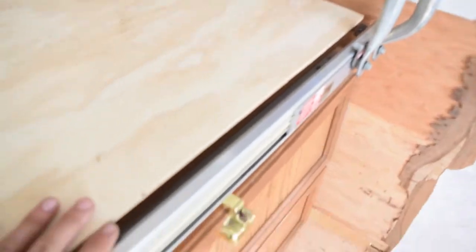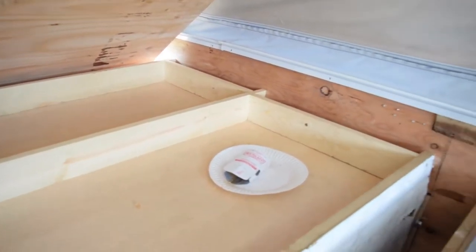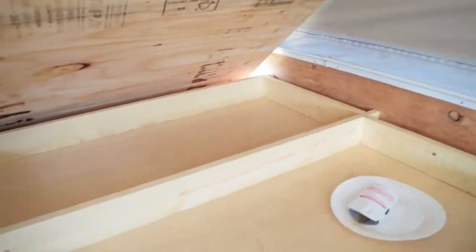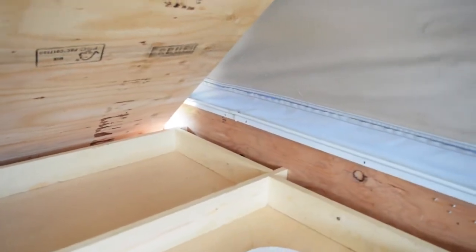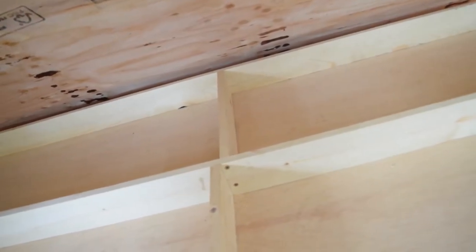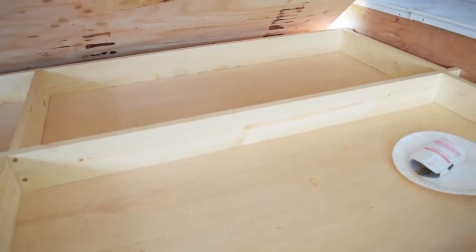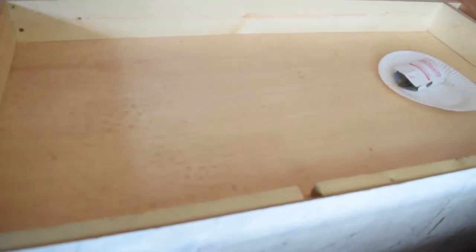Basically, we built everything from this rail all the way forward. And you can see in here a hot pocket from yesterday. And it's just lined with 1x4s all the way around. It makes it really strong. These are around 7 feet, these 7-footers go all the way around and add a ton of strength to the plywood underneath. So there's no give or any play in that at all. With a person on it, even two people, it's totally fine. A lot stronger than it was before.